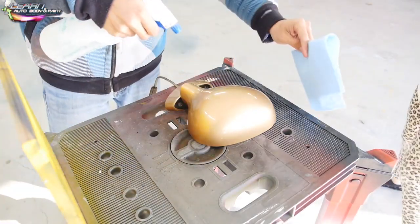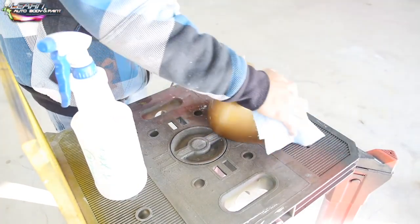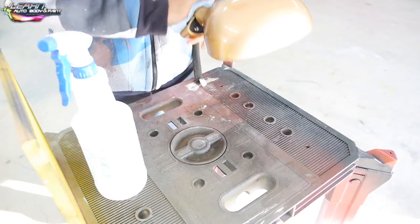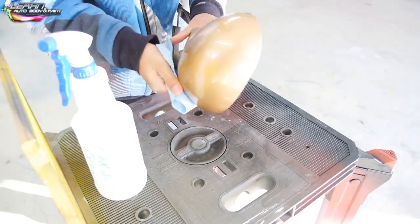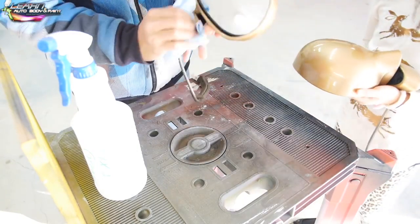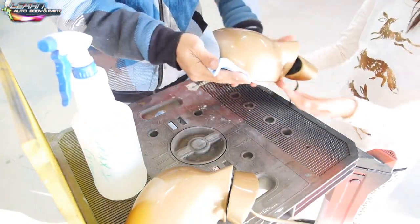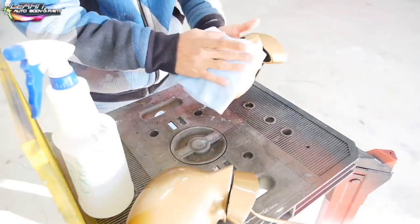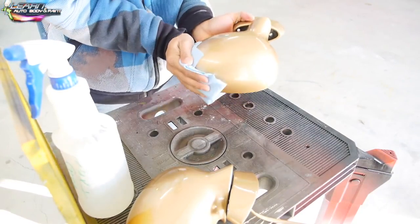Yeah. I remember we peeled it off the rims. Oh, wow. We got glossy. Okay, so it's good to keep it glossy, right? We don't want to sand it or anything when doing Plasti dip, because that'll actually give us a problem when we want to peel it off. It won't peel. Because the smoother it is, the easier to peel.